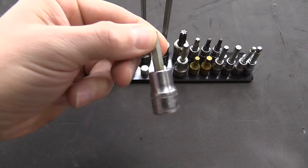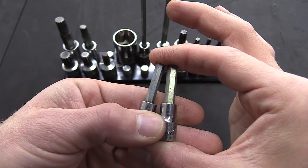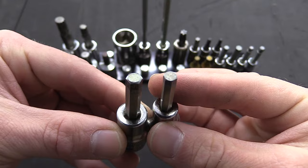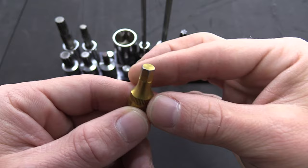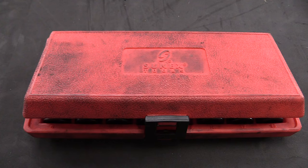We're also going to need a variety of ways to take off allen head bolts. The most common are five and six millimeter. I have stubby five and six, mid-length five and six, five and six ball end, standard length five and six on three-eighths drive, and the extremely long ball end. It's also not a bad idea to have shorter quarter-inch drive ones because so much of the area we work in is incredibly tight. You're going to need more than five and six — four is semi-common, and seven, eight, and ten are also used.